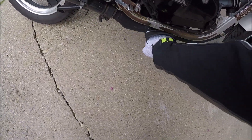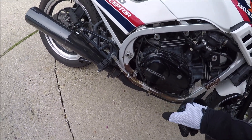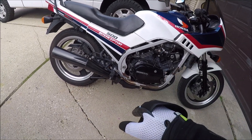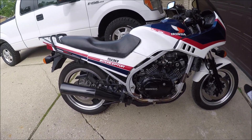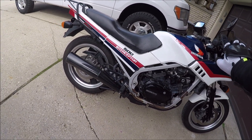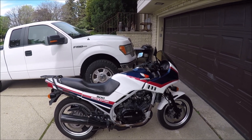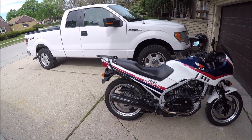Do you see how this is all swollen? This is supposed to be 90-degree angles. Honda put out a bulletin in 1986 — somebody on the VFR forum showed me — water gets in here from rain or washing, freezes, and pushes it out. Mine has the same type of corrosion, not nearly as bad. The last thing I'm going to do before I give it back to the owner: we're going to put tires on, put braided lines on the front, take all the rust off, and spray-bomb it with the right Honda touch-up paint, masking everything off with aluminum foil. Lipstick on a pig, but it's not a show bike. I'm glad I did this because now I know I've got major problems with mine. If you've watched this far, thanks for watching.